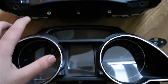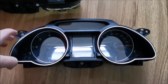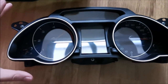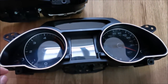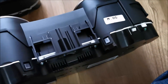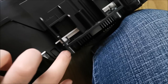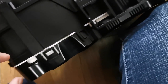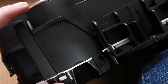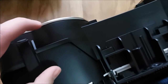Another thing — I will clean both clusters really well because I don't want dust getting inside, so I need to make sure the outside is clean first. I will start working on the A5 cluster; I haven't touched mine apart from cleaning it. Undo this screw, this screw, and this screw to see what's inside. Actually, made a mistake — those should not be undone; you should undo the ones from the back. So if you undo those screws and undo the clips, you should be able to take this whole assembly apart — everything above the white line should come off.